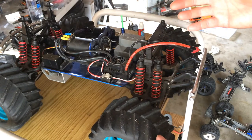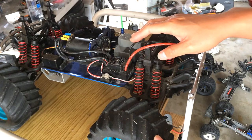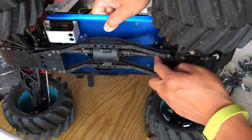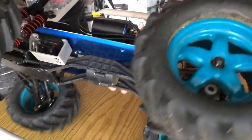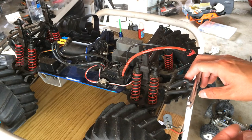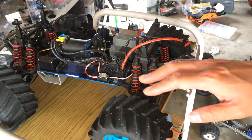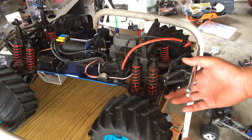Using a larger motor like the Mamba Max, Mamba Monster, or some of those larger 1/8th scale monster truck motors in this chassis will result in a lot of damaged parts. This truck has plastic axles — going to the front differential, the rear, and out to each of the tires. It's a complete plastic driveline. Putting in a higher-powered, higher-torque motor is going to break stuff. Replacing the plastic axles is fairly expensive — about $50 to $60 for the fronts and rears each, and probably another $50 for the front and rear driveshafts to convert to steel. So not cheap.